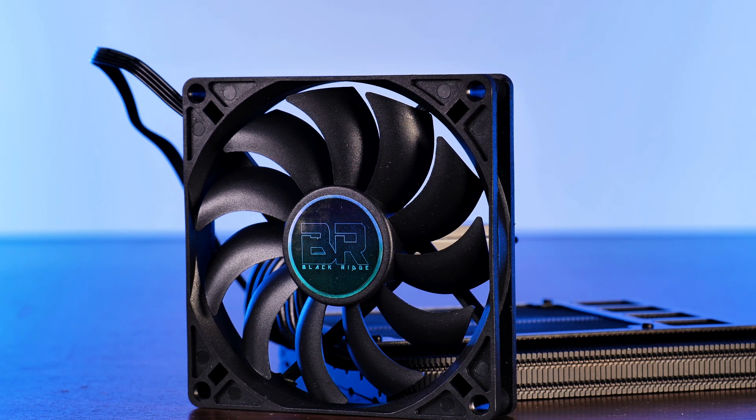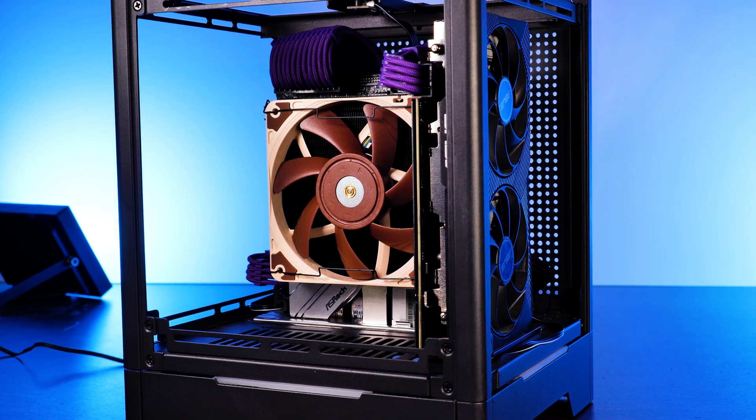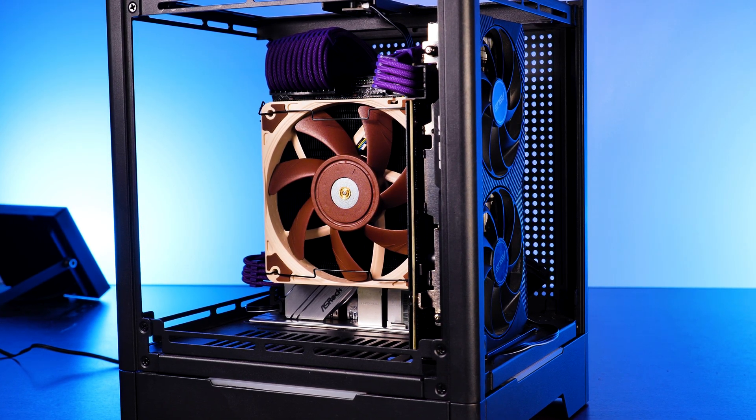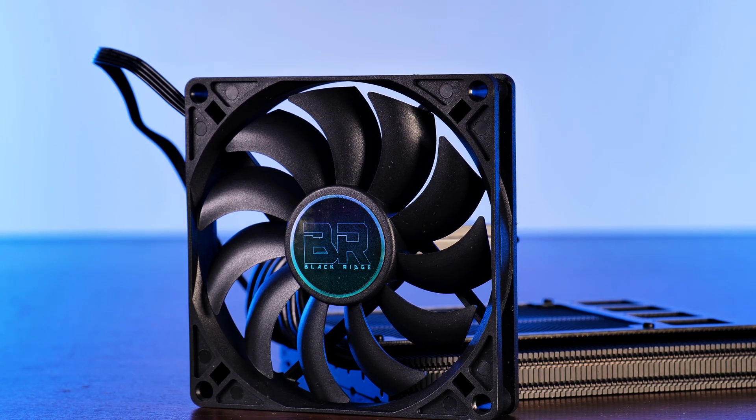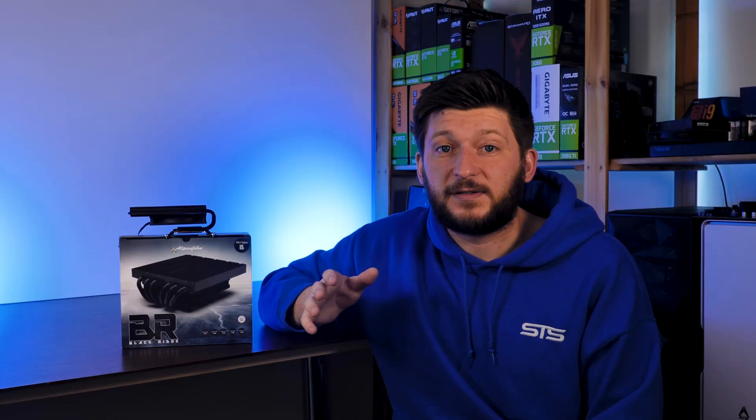There is something causing this: this fan. I believe this little 92mm fan is the very reason why the Black Ridge turned out that bad — and I can prove it. After removing the mini fan and installing a Noctua NF-A12X15 on top of the heatsink, we re-benchmarked everything. This time, the Black Ridge completely annihilated every other ultra-SFF cooler in our benchmarks, keeping the 10700K at 45 degrees C above ambient. That's 16 degrees of difference. In what world is 16 degrees C difference explainable? If it had been 4 or 5 degrees, I'd be okay — 92mm versus 120mm can make that kind of difference. But 16 degrees just shows me that the original 92mm fan is just bad. Really bad. 16 is way too much.